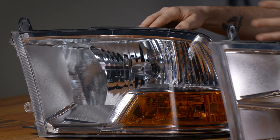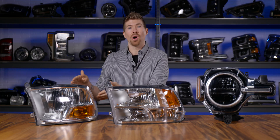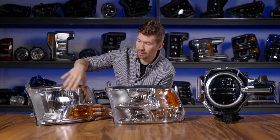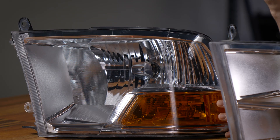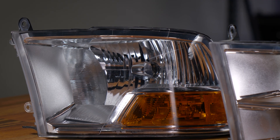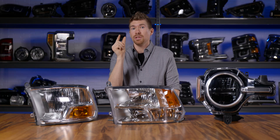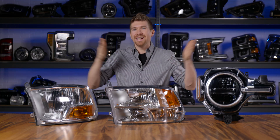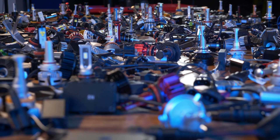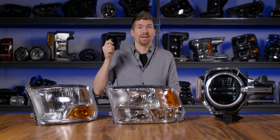This one right here uses a dual filament halogen bulb, so it uses the same bulb for low beam and high beam — that's why you only have one reflector area. The reflector is these fluted lines on the inside, as you can see. The lines go up and down and work their way out. Think of those reflectors like a mirror: the halogen bulb is illuminating, bouncing off those mirrors and then aligning onto the wall to give you that beam pattern. You can about guarantee that you're going to get an improvement over stock if you put in one of the LED bulbs we have tested.